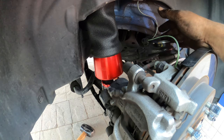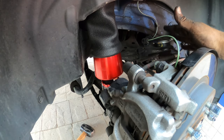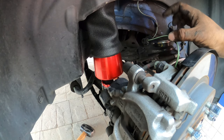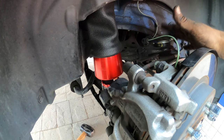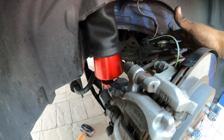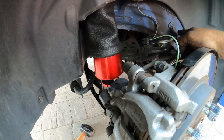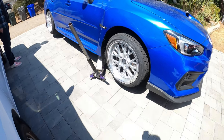The fittings that I'm gonna be using are not gonna be provided by Airlift. I go above and beyond when I do fittings on these. I don't like using Airlift fittings since they tend to leak a lot. Since they're plastic fittings, we're gonna be using full-on brass nickel plated fittings that will last pretty much the entire life of the air suspension without a single hesitation. Very, very good investment, but it's not cheap. You're looking at about $15 to $20 a fitting. So make sure before you buy your fittings, you put it in your budget as well during this entire build process. All right, guys?